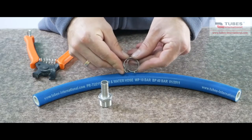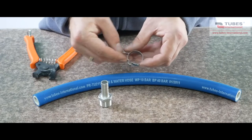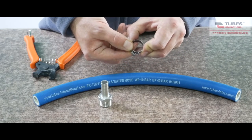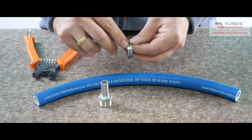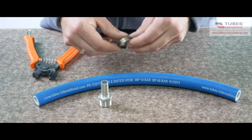Let's start with DCL clamps. It's made from a single length of band with a loop formed into a ledge. The compression force is evenly distributed along the ledge, and the smooth inner surface of the band protects the hose from damage. The clamp is made of 304 stainless steel and color coded with a strip for easier identification.